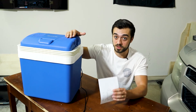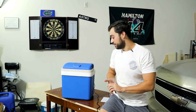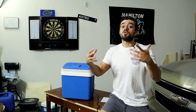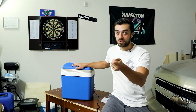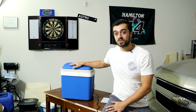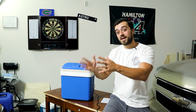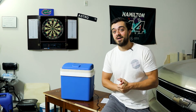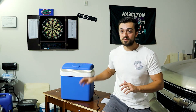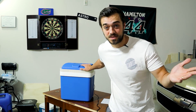The main reason I got this was hoping the chiller would be more efficient. It was advertised to be 32 to 40 degrees below ambient, but it only got about 26 degrees below ambient — 64 degrees at 90 degrees in the garage, pushing 97 degrees through the exhaust. That's something to factor in if putting it in a camper van or truck in a small confined space. I bought this hoping to use it for a DIY AC experiment on my other channel. It's not going to work for my uses, but if you're traveling for a day or two with some ice plugged into your car, it'll get the job done. I'm going to send this back and get a compressor-style fridge — the cheapest used one I found is $135, just about $45 more than this. I'll be reviewing that next. If you're interested in seeing the DIY AC system, check out my other channel Bills United. The compressor-style fridge pulls 45 watts per hour instead of 60 and gets below freezing. If you want to buy one of these, it'll be linked below.